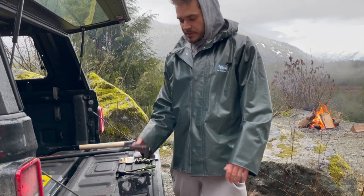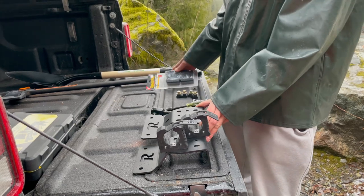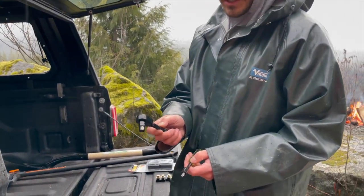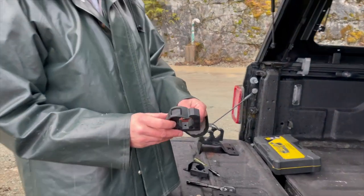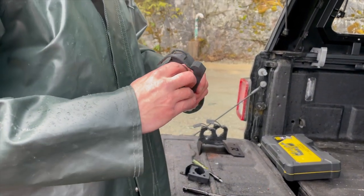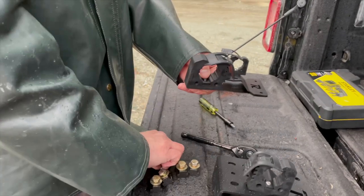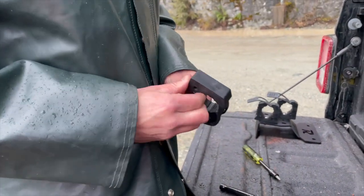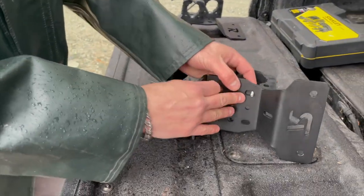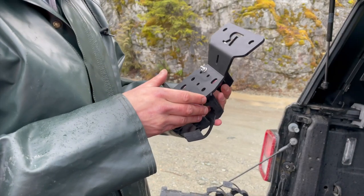The extensions aren't going to work on this, so we are just going to use the tops. I've got this one started here with two clamps — I'm going to put two more quick fist clamps on here. I've just got a Phillips and a 3/8 ratchet. The quick fist comes with a little plastic washer — slide it in, drop your stainless screw in, and put it through. When you attach the extensions to the top of the RAGO mounts it makes them too long — from the bed rail system of the Jeep Gladiator to the bottom of the bed, with the extensions it's too long and you're unable to mount them. So we just used the top mounts and it worked great.